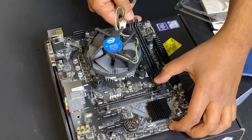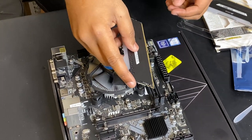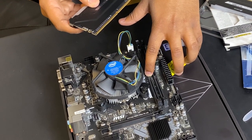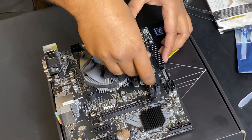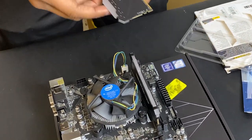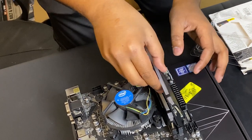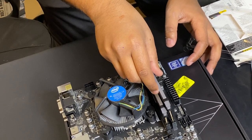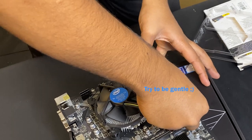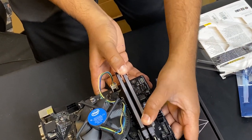Since there's only two slots, we're going to open the tab and push down. We're going to check the correct orientation — you'll see a slot and a little plastic piece that aligns the RAM. Just push down until you hear a click, just like that. Then install the other RAM stick. This is a 16 gigabyte kit, so you get dual channel. The kit I'm putting in the description is a 16 gigabyte kit for around $60. If you don't have the funds right now, you can get an 8 gigabyte kit — lower performance — but once you have the funds you can upgrade to 16GB. Push down until you hear a click. And that's installing RAM.